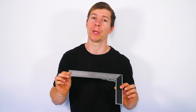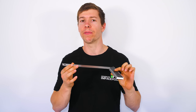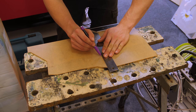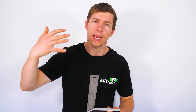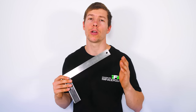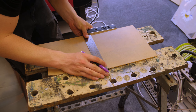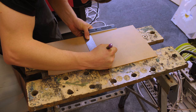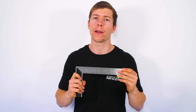My first choice for getting started into PC modding would have to be either an L square or a T square with a ruler on top of it. The reason one of these comes in handy is you are able to create straight lines to score down and create different shapes and modding techniques on pieces of acrylic. Not only is it good for creating straight square lines, you also have the ruler on there so it serves a double purpose — you can measure lines to the correct size, or measure how long or wide you need to cut certain panels in your case.